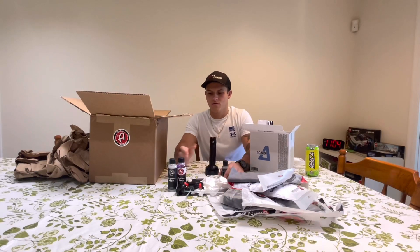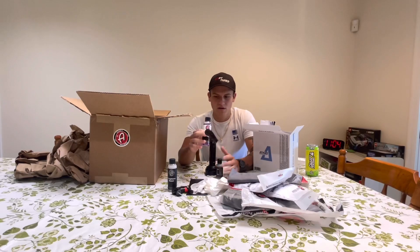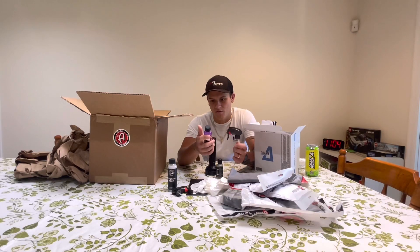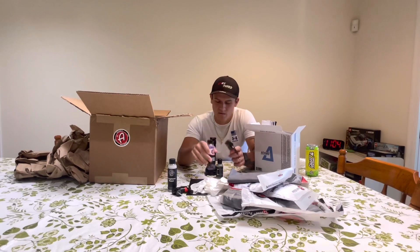Pretty much, whenever you first want to start off, you begin with the Surface Prep. You're going to spray it on a towel and clean the wheel really, really good. You want to make sure it's clean and clay-barred — these things are brand new, so I don't have to worry about that, just going to detail spray it first. Surface Prep is pretty much just a blend of isopropyl alcohol and some of their other stuff. It removes traces of cleaners, polishes, and residues.